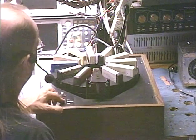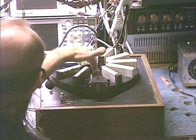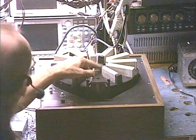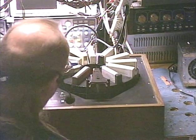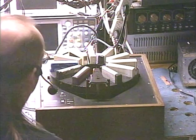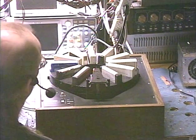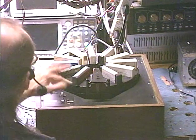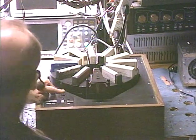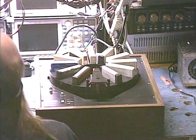Alright, let's turn her off. I would not advise keeping a cartridge in the play position because it keeps it pressed down against the capstan and it'll eventually put a dent in the tape's roller. Anyway, she's been put through the paces — as you can see she occasionally skips a track or repeats a track. It's just a clunky design; they didn't keep those timing shapers in, and that's got a little to do with the false changing and non-changing. It's probably a lot more uniform with automatic operation.